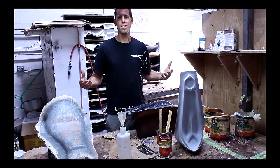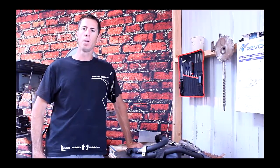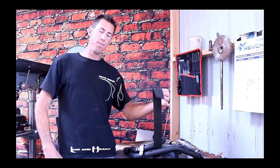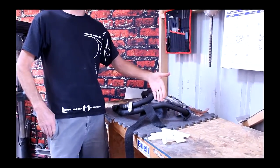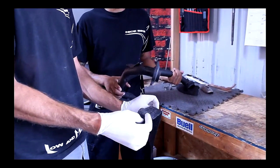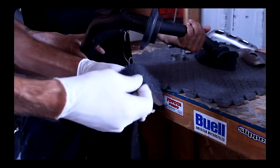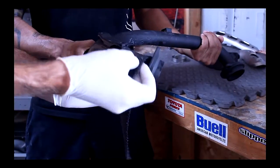Here's Chris with a DIY tip this week. The do-it-yourself tip from Low and Mean is how to wrap your exhaust pipe. Low and Mean is gonna offer you a kit that comes with 50 feet of fiberglass exhaust wrap and a couple of clamps to help you install it to your Star Bolt exhaust. To get started, you want to drench the fiberglass roll into a bucket of water. Suggest putting on gloves because the fiberglass will come off on your hands and possibly irritate them.